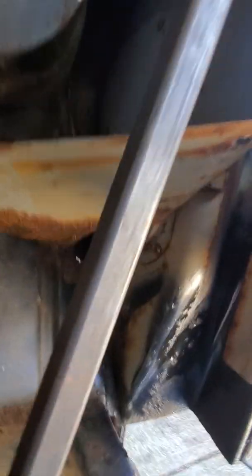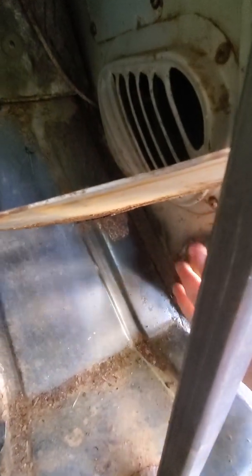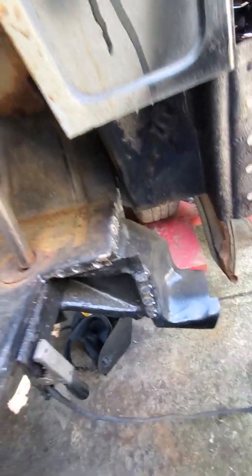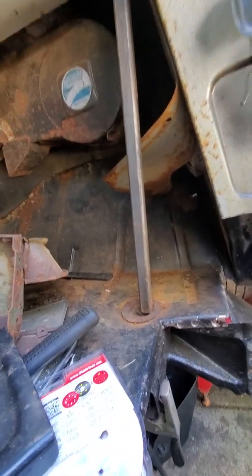Kind of hard to see, but there's a vent here, right? When it gets plugged up down here, it comes out this vent, so you get water coming out of this vent. Then there's this little panel right here that I'm touching, and I've bent him up because the bottom of him's all rusted out. But he covers the backs of the hinge pockets inside of the A-pillar. I know you're probably dizzy. So it'll run down here, it'll rust out the floor, it'll run down in here, and it'll rust out all of this. That's why I've got to replace all of this. That's what happens here in Washington, those pine needles kick your butt.